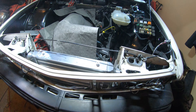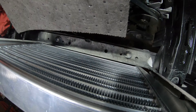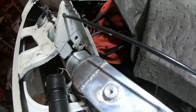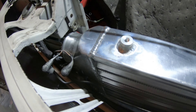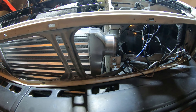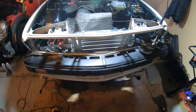Here's where we're at so far — cut both sides. I cut down in there a bit; I'm trying to lighten it up so you guys can see that. I've got to smooth that out a bit, I'm going to come in a little bit more there, but right there we should clear and the radiator should be able to fit right in there still. So right there is where we cut — a square out of there, square out of there, grind it down a little bit in there. Going to smooth that out and smooth out all the other spots through here, then put the headlight housings back on and see what else we've got to cut on them. I think we're about done cutting on the body, luckily. Not too bad.